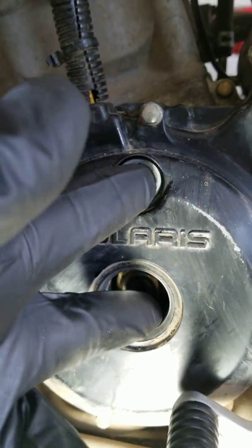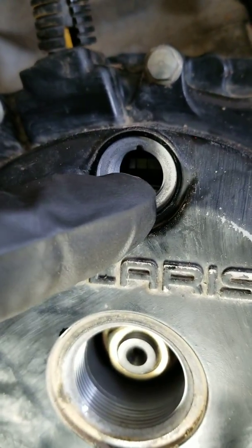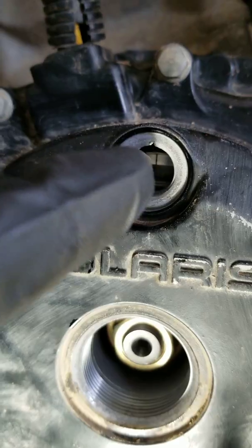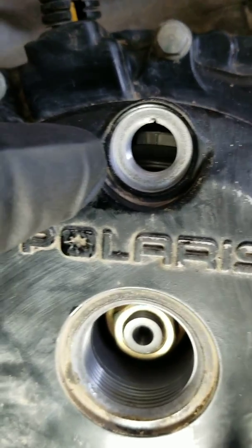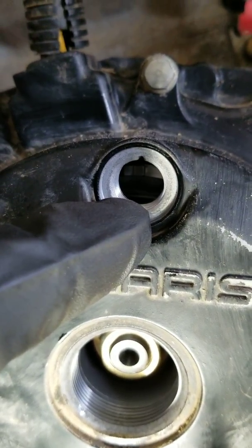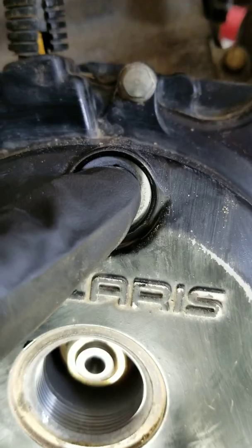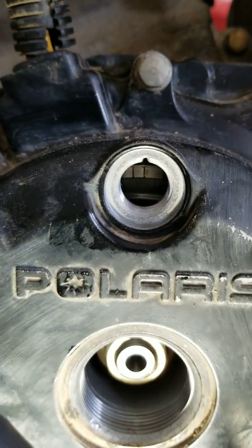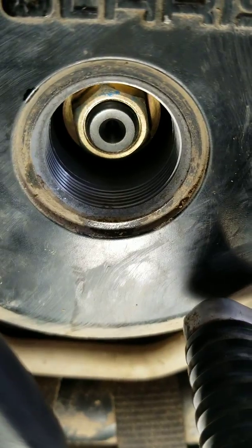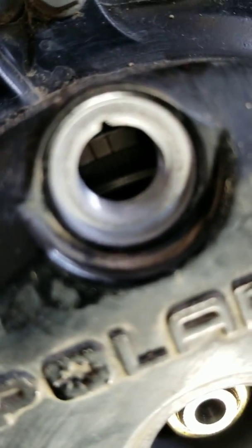So we got our two covers here and pop those off. I didn't have a line next to a T on the mag here, so what I did have was three lines, a space, and these two lines. I realized that top dead center is the last line out of the two. You mark that up with this notch in the case right there and that's where you have top dead center. You're gonna spin that 19 millimeter nut counterclockwise going this way until that is lined up with that second line out of the two with the case.